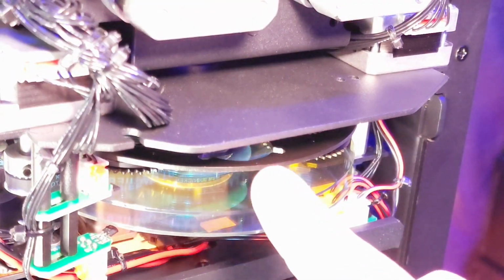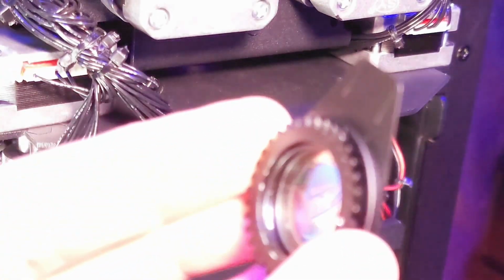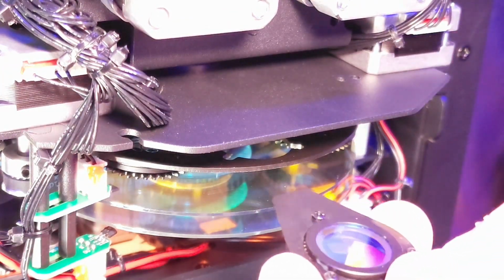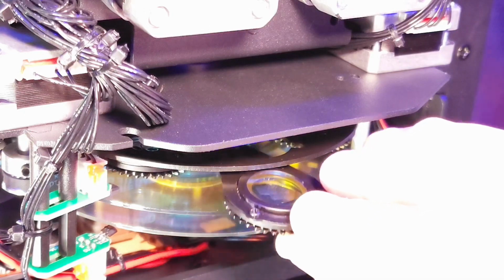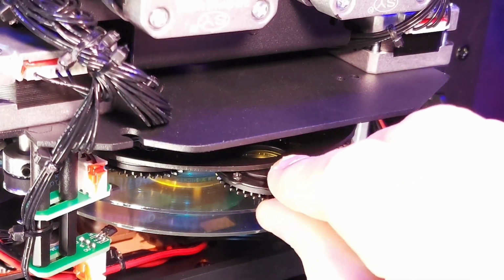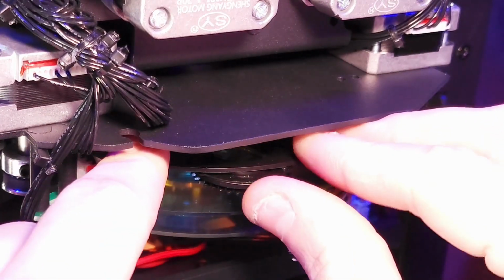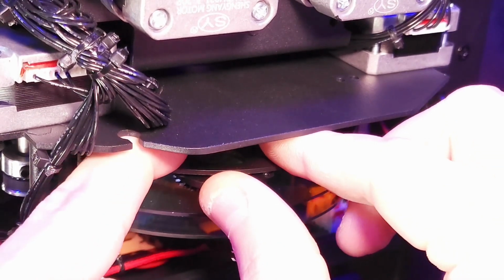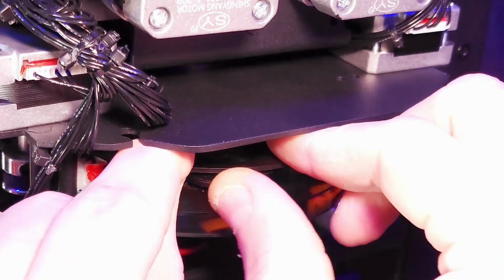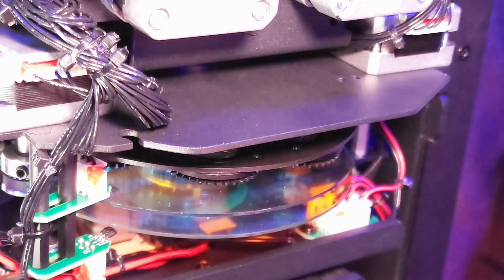It's a little hard to see, but there is my empty slot that I'm going to put my slot and lock gobo back into. Now make sure that the gears are facing downwards, so towards the bottom of your light fixture. And to put it back in, you're just going to push it into its lock, and you'll actually kind of feel it go under the little clip that's included. However, it also needs to go upward, so make sure that it's fully seated, and you're going to hear it clip upwards. So now it's actually clipped upwards.